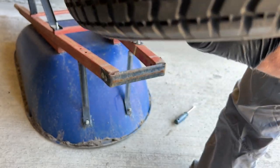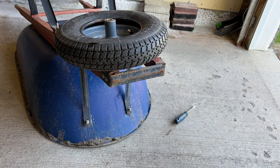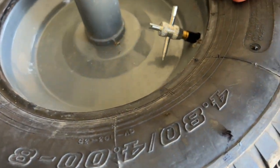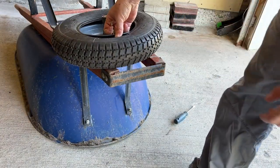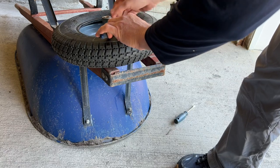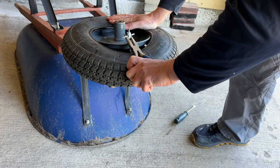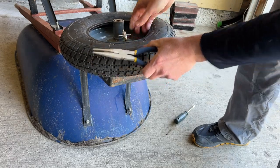Put it in there and reach around on the other side. I have a little trick - I have this little tool for changing the valve core. It screws on top of the threaded part and gives you something better to pull on. Then take a pair of pliers, use the rim as leverage, and just wiggle it. Makes easy work of that.